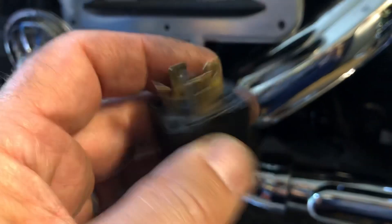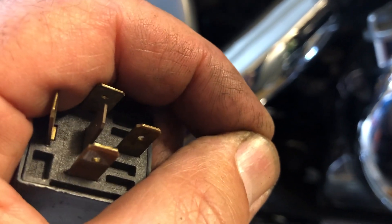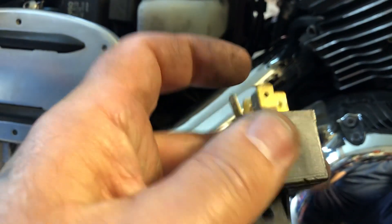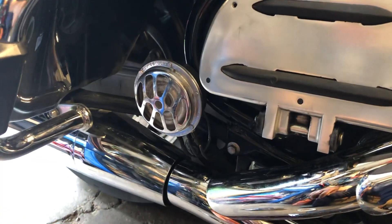I took the wires off the horn and connected them to a horn relay. All the horn relay is is a switch. You can feed the control terminals with skinny wire because it doesn't take much power to energize the little coil inside. When you push your horn button it closes the switch; when you let go it opens the switch. That closing connects the two terminals with a direct path from the battery to the horn, through the horn to ground — just like a light bulb.